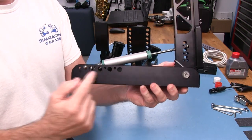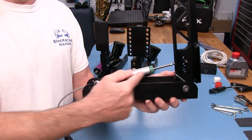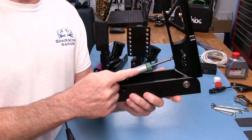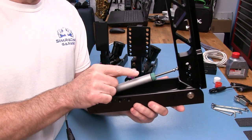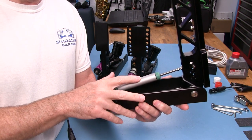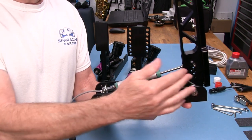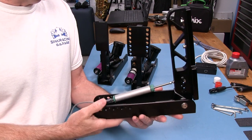There's an adjustment for reach. We can also change the angle of this resistor — a linear potentiometer, or linear position sensor. These tend to be very accurate, so I like that they're actually using this. We have holes here so we can adjust this if we're changing the angle of the pedal itself. We'll go over the adjustments later on.